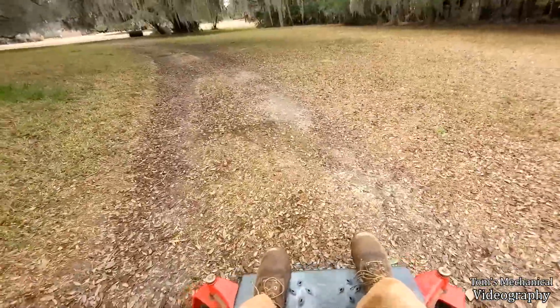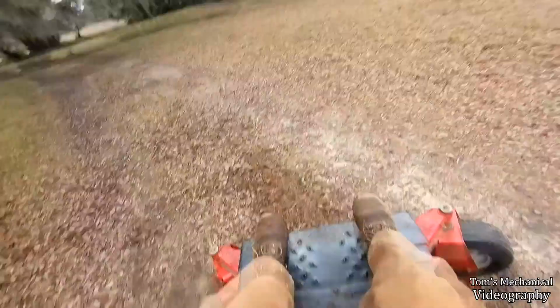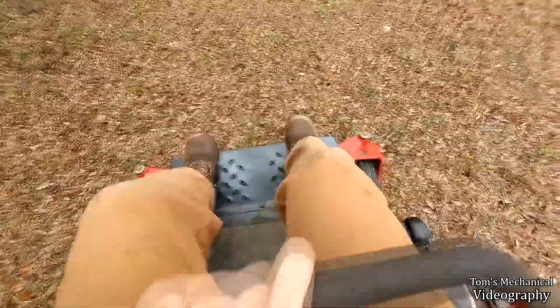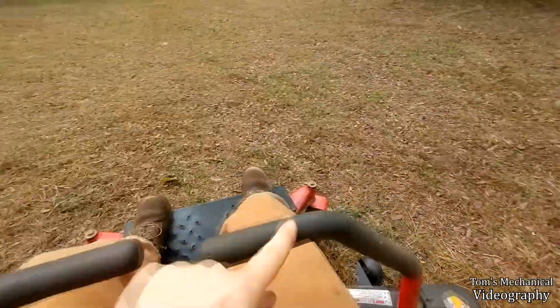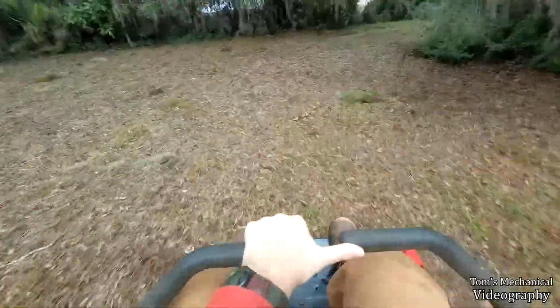She's quick. We haven't been this quick in forever. Woo! That was most of my problems, I think. I still have an unbalanced transmission. As you see, these are different lengths. And then when I back it off, still different lengths, but that's on purpose because she spins to the right, because something's up with the hydrostats. This left one's a little bit more worn. So I had to balance these so that this one bottoms out differently so that I don't just spin in circles. But anyway, I digress. She's perfectly fine now.